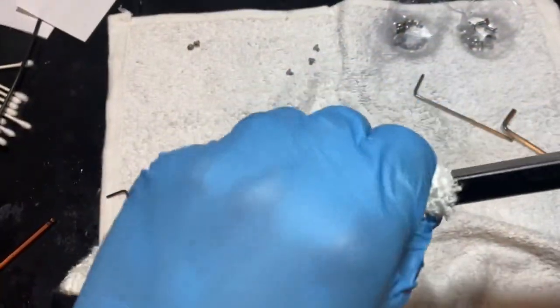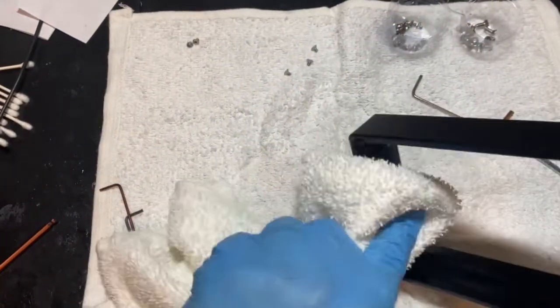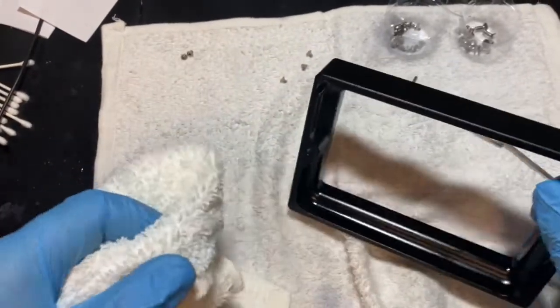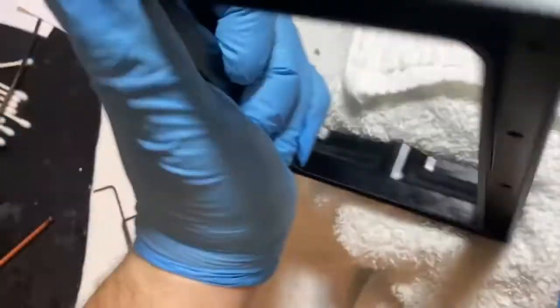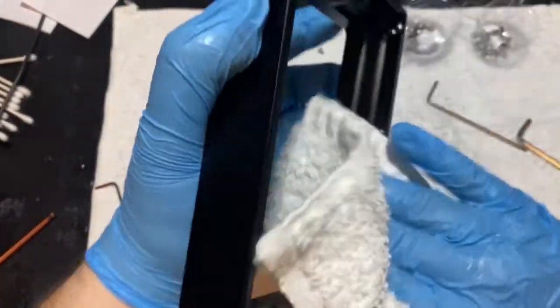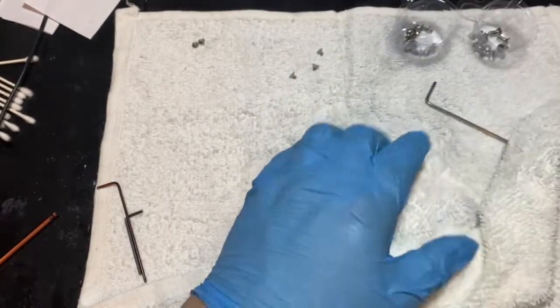Through the magic of camera, I'm going to switch scenes here. Because I've got alcohol and resin on these gloves and I'm going to be handling new FEP film, you need to replace your gloves or use clean gloves — even if they're resin free. I've always worn gloves just to keep extra fingerprints and oils from getting onto the new FEP.